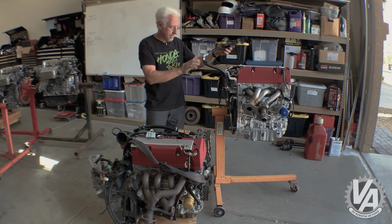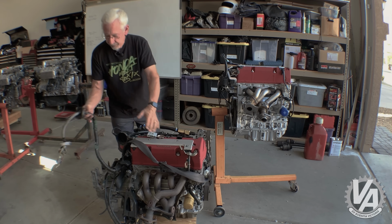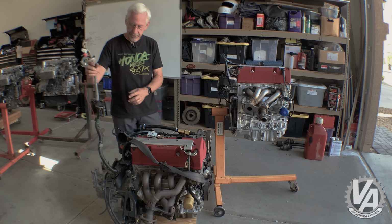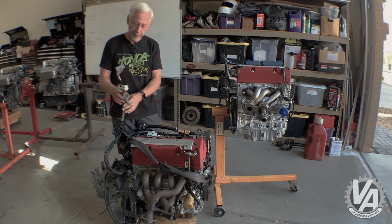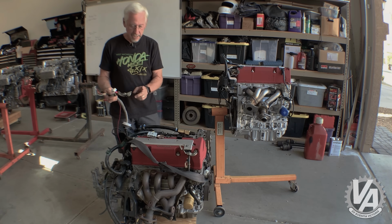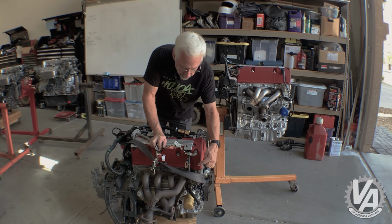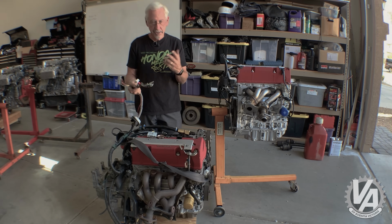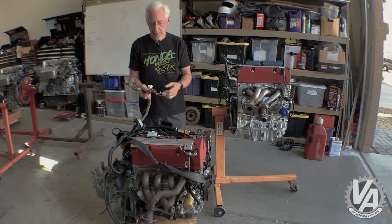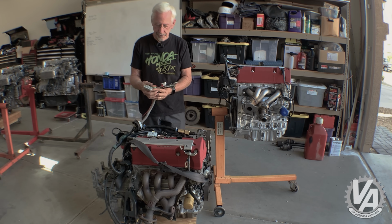And the lengths are fine. On this Integra Type R, this is a little bit different. This is actually slightly shorter because it doesn't have to reach as far to get into the firewall. Remember, this is a right-hand drive car this comes on. Again, the big differences are, number one, there's no VTEC oil pressure sender on this, and again, you can disable that with a K-Pro, or if you're using K-tuner, you could also disable it.